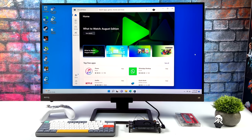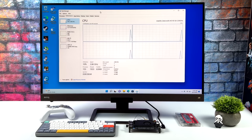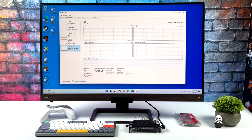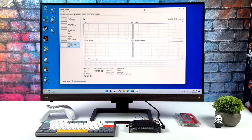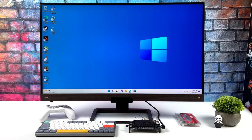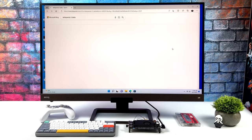Using this as a regular PC, everything's working out pretty well. I'm connected to my Wi-Fi 6 network and everything loads up really quickly — pretty snappy little system. One thing I noticed: the RAM is in single channel. These iGPUs really benefit from dual channel since the RAM is also used as VRAM. It's 8GB at 2933MHz but in single channel, and that is going to hurt GPU performance, especially with a lower-end chip like this.